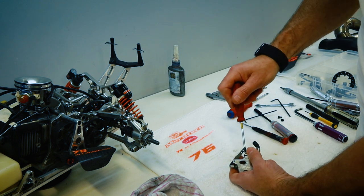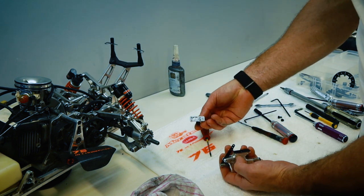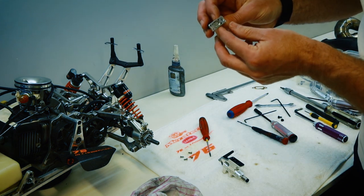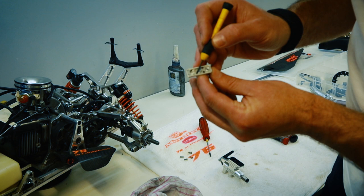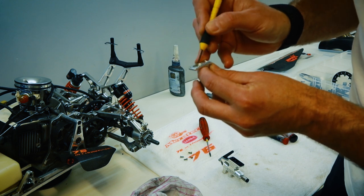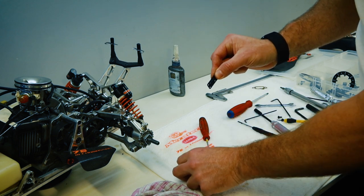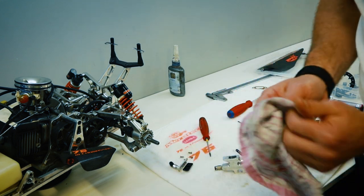These are a good design. There's a volume compensator that sits under the lid here. So that's where it sits. Another thing to look out for in maintenance is that the breather in under there is clear. And you can see there on this some junk in around there. So that's what we're looking to eliminate. We don't want any of that in the system. As the fluid expands in there, it compresses against that diaphragm and moves. So if that hole there is blocked, it can't compensate for the expansion in the fluid from temperature.